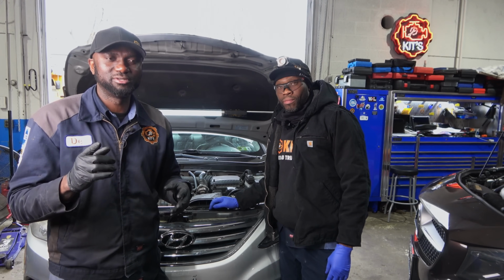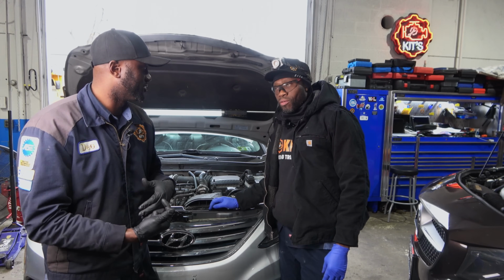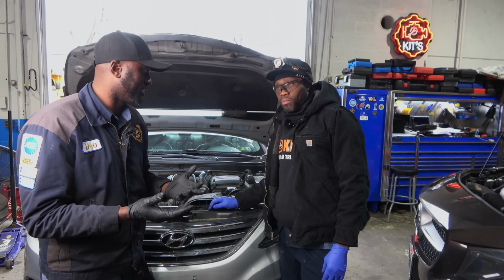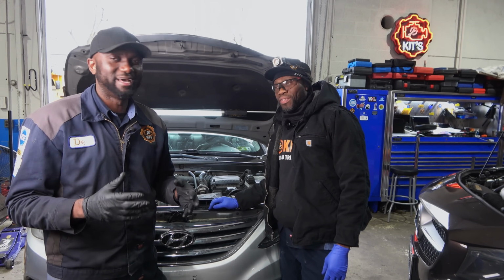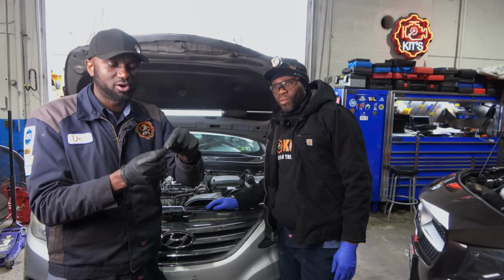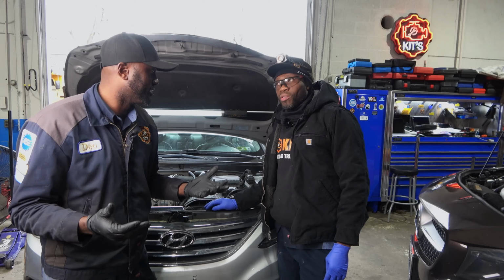And then I thought about a test that I usually do, but I forgot to do yesterday. We can use a bore scope and put it in the cylinder to see if we have a valve that's sticking open. Or maybe we could also have a broken valve spring. So I told Robin, you know what, we should do it. Let's do it tomorrow morning and see if we can find something. Because if we have a broken valve spring on the 3rd cylinder, it's going to cause the valve to stick open, and that can cause low compression. Or we could have something going on in the cylinder.